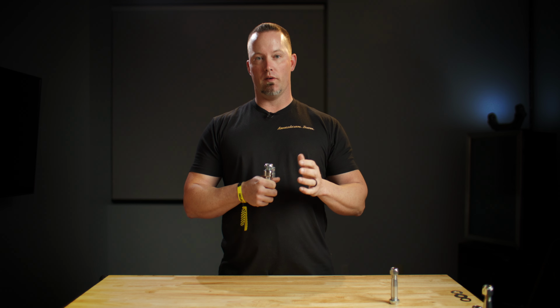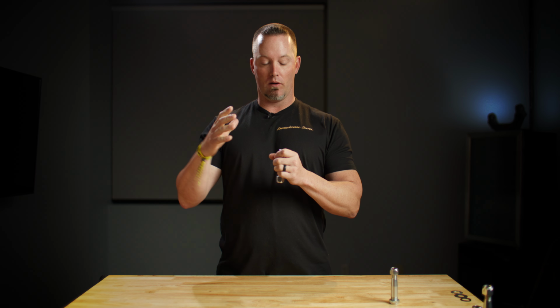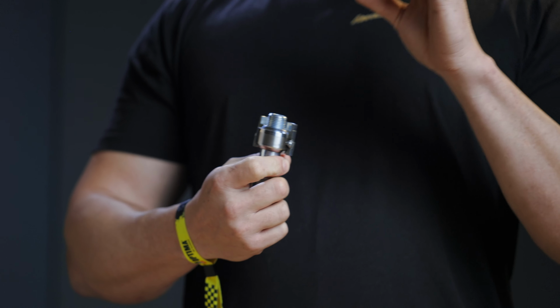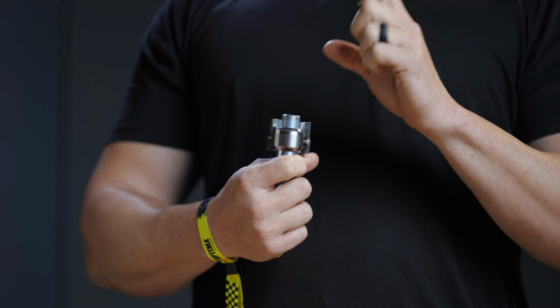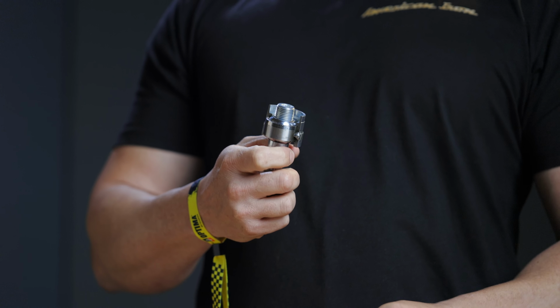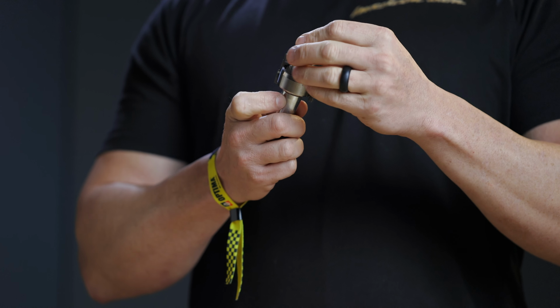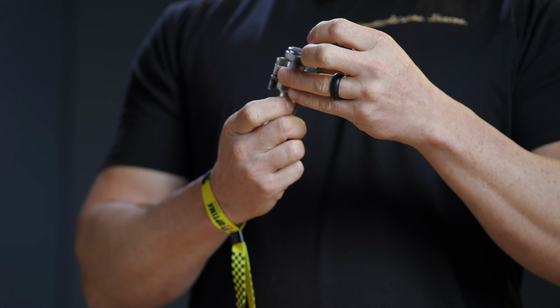What we typically see on the trail with a ball joint failure is a U-joint or a shaft is broken and contacted the lower ball joint, and that means the whole outer is coming off of that vehicle. In a ball joint delete system, we've eliminated that problem altogether. We've seen shafts break and U-joints break, and it can contact the upper, but since the double-ended stud is there, that whole thing can't come out because we are captured on the top and the bottom.